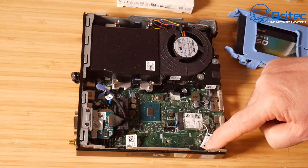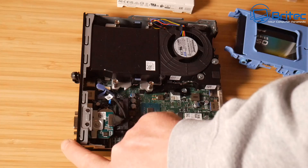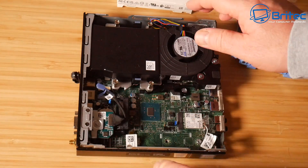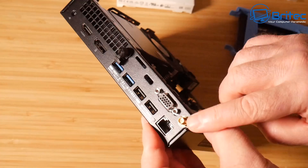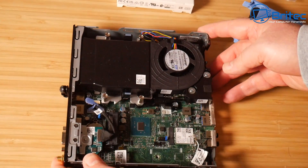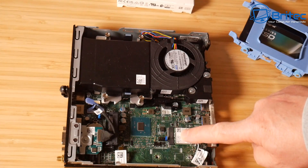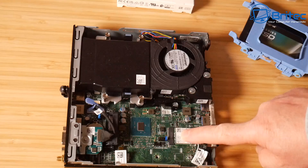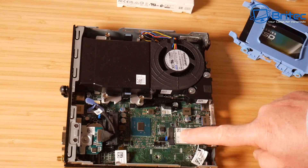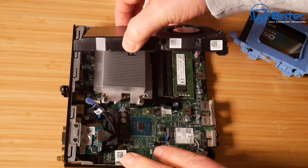You can look for a fast upgrade for the NVMe slot. The Wi-Fi antennas run along the side and there's a little punch-out which you'll need to punch out — these units don't always come with Wi-Fi cards. So make sure that if you need Wi-Fi, it's already included, otherwise it's an added cost to go out and buy a Wi-Fi card with cables and antenna.